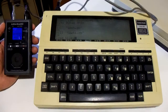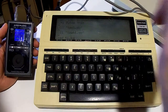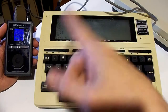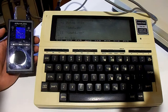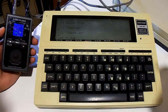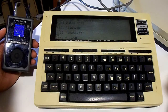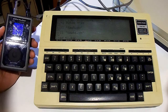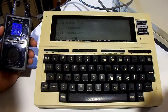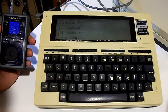So if you don't have that, what you do have is a digital audio recorder of some sort. You can actually use that instead of the CCR-81 to load and save your programs. Make sure you have the cord. If you don't have that cord, you can get one at Club 100 still, I believe. Or you might find one on eBay. You can also make them. I'll provide a link for that and other sources at the end of the video and in the description below.